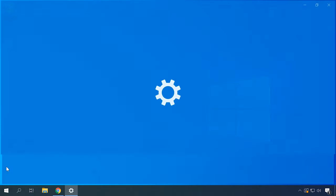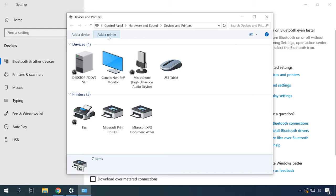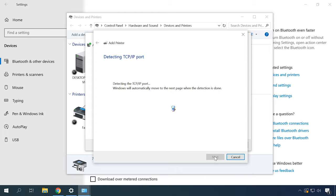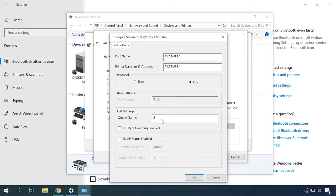Configuring a printer from PC: if the printer is displayed correctly in the web interface of your router, move on to configuring printer options on your computer — I will show it with the example of Windows 10. Open Settings – Devices – Devices and Printers. Click Add a printer and choose The printer that I want isn't listed. Tick Add a printer using a TCP/IP address or host name and click Next. From the drop-down list, select TCP/IP device and set the IP address of your router — this is the same address you used to open its web interface. Click Next again. The computer will start detecting the port, so you will have to wait a little bit. Select Device Type as Custom and move on to Settings. Set LPR protocol, give any queue name and click OK to confirm your choice.